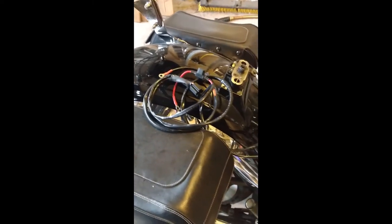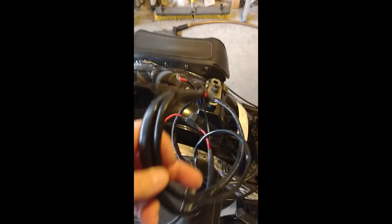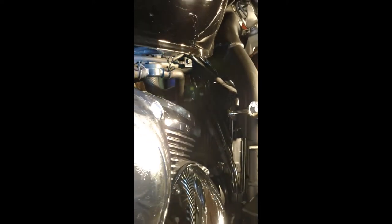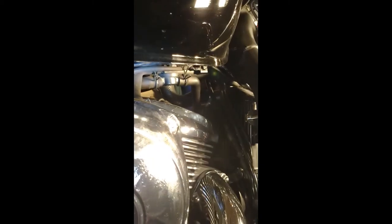This is the unpackaged Denali Soundbomb — a quick wiring setup, so it's all plug and play. It looks fairly straightforward. You have your relay socket that came with the Soundbomb, and that plugs into the relay socket and should be in close proximity to the battery. You have your battery wire leads and your positive fuse. When you're routing the wires, you just want to make sure you keep everything away from any heat elements because you don't want the wires to become vulnerable to heat and get damaged.